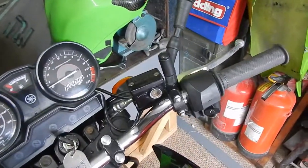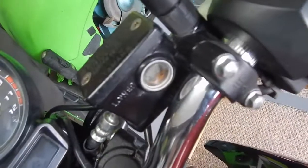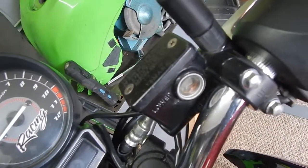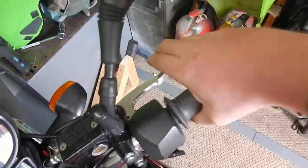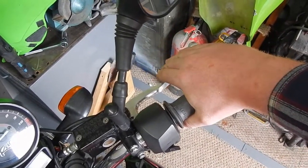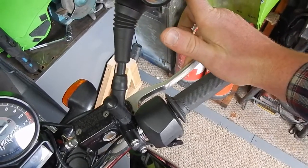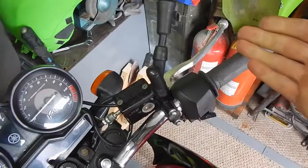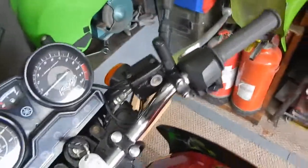Brakes: the first thing you want to be checking. If you have a hydraulic brake at the front, which most modern bikes do, you want to be looking at your fluid reservoir. This one looks a little bit low and the fluid looks a little bit dirty. Also check the free play on the lever — there should be a slight bit of free play — and make sure the brake lever doesn't touch the handlebar. If it's spongy and comes all the way in, that suggests there's air in the system, which is a bad thing on hydraulic brakes.